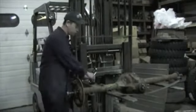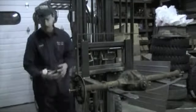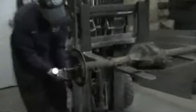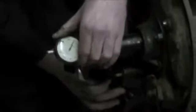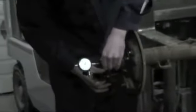What we're going to do first is show you how to check your end play. You get a dial gauge like this — there are various different kinds. This one is magnetic, it just sticks on the end. You get it on the end of the axle, and this dial will move in and out. Set it to zero, move it in and out, and this will tell you your end play.